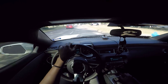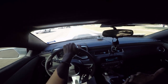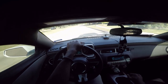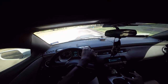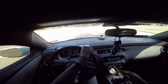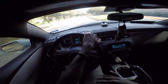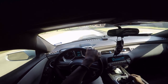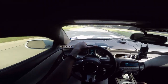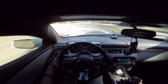A lot of people are saying it's the transmission oil and different things, but I don't think that should be the issue if it's grinding and locking you out at the same time. I haven't done any hard pulls with this stick yet, but I have with the other stick — and from a dig it grinds every single time going into second, absolutely grinds second like no other. It's a lot louder than normal, which is why I bought this to fix that issue. Other than that, it's a great shifter, I love it so far.